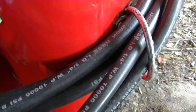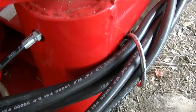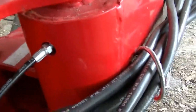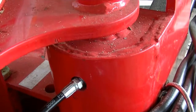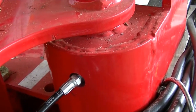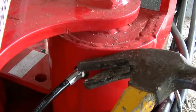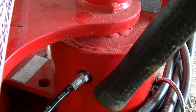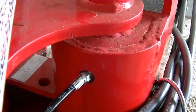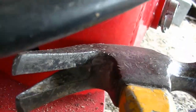What I did is I took the end of a hammer. I'm not going to stick it in there now because I've already greased this enough and I know it'll break — I've had to replace the top fitting after getting it stuck. If you don't pull it straight out, fast and straight, it'll break. So I positioned the hammer around the end of the hose and popped it out straight — one motion, boom, it came right out. Do it that way and you will not break the fitting.